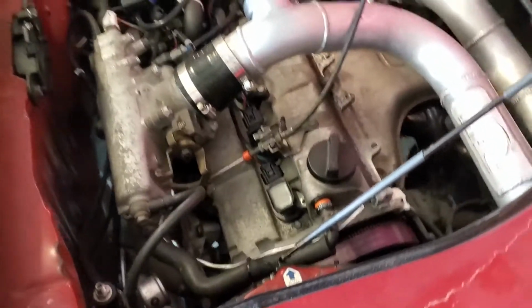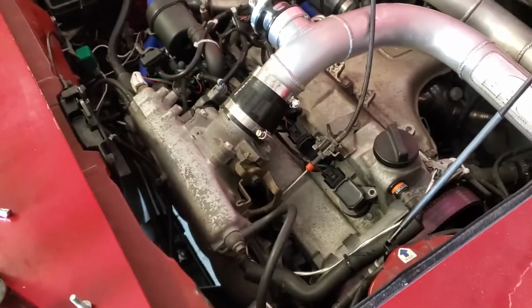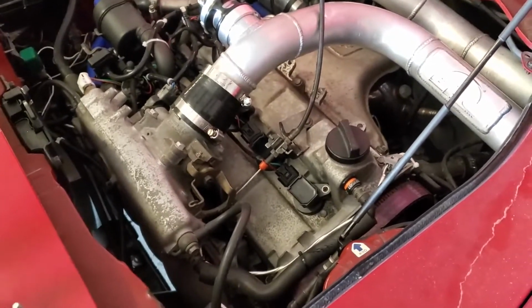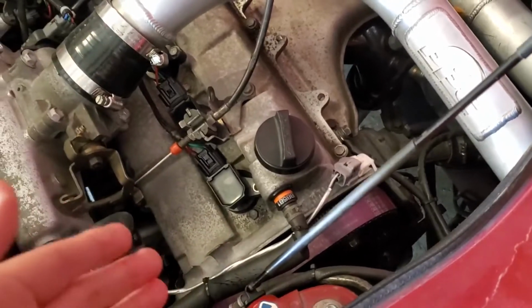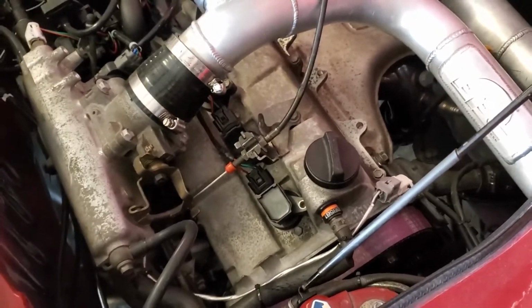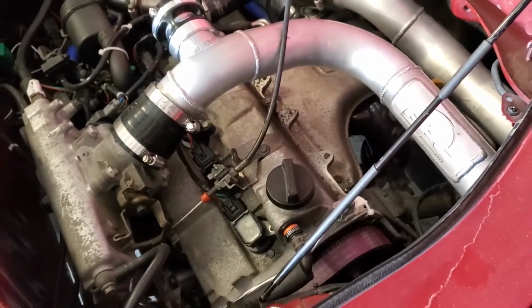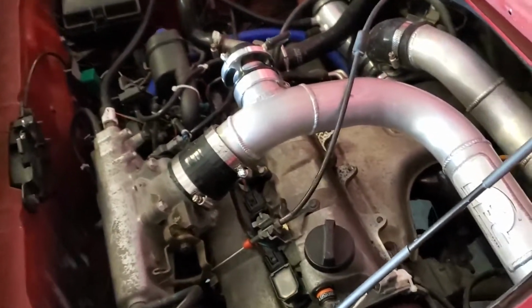So reading through the MS3PRO manual and watching some videos online, my issue should be, in theory, that I've got to reset my tooth number 1 angle, or in other ECUs, the offset angle for your ignition timing, right? So I've got to reset that. I've got to zero everything out, and I'll show you that on the software side, and reset the timing.